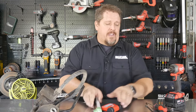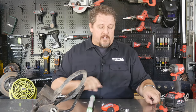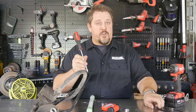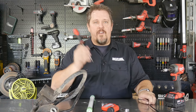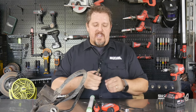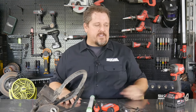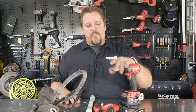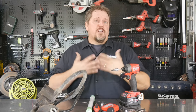A couple of lights, so it was handy, so you could see on the camera. A 13-millimeter wrench, my sonic screwdriver, which may make sense to somebody that knows Doctor Who. I don't, but anyway, a flat blade screwdriver, a couple of zip ties that I added to the loom that it came with, and some side cutters to trim the zip ties. And then I use my impact driver with a T30 Torx bit on it to remove the filler neck.